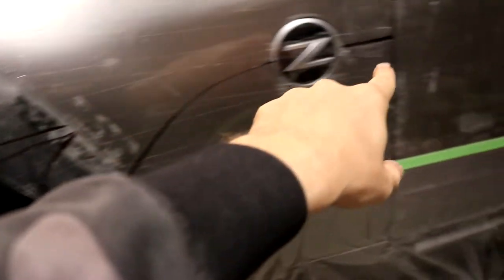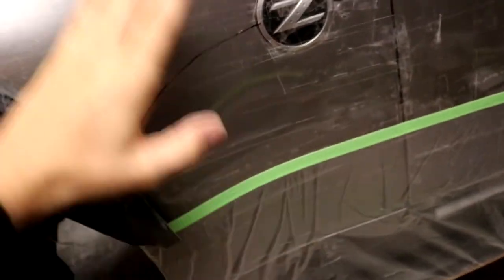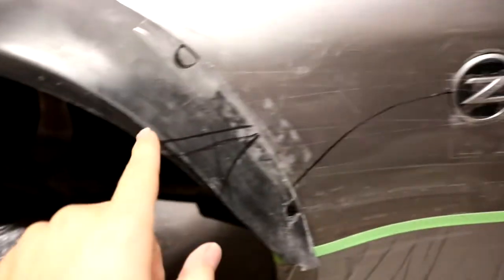So I'll pull it off of there, we'll make that cut, and then we'll put the flare back up on the car. And then, before we do any sculpting or anything like that, I'm gonna actually head to the front and I'm gonna make some templates for the front area as well. Might as well get all that out of the way right now, because when we start to lay up our clay, you wanna make sure you have all of your lines, especially the outlines, so you know exactly how much clay you need to lay up and you're not just laying up a ton of extra clay that you don't even need. So let's get that cut off and then we'll head to the front and do some more templates.